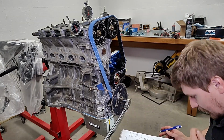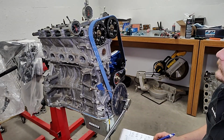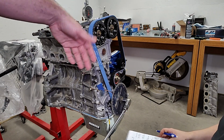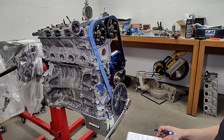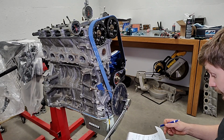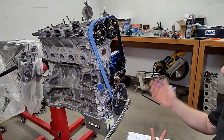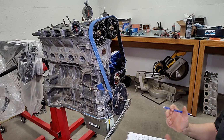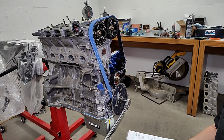Exhaust is on the nuts at 112.5 degrees, so I'm not going to be able to knock off a 0.5. Chasing a half degree right now is kind of pointless because you're very well going to move this anyway. After I've degreed them and we put them on the dyno, we've been super ecstatic with the power, so we've never gone hunting. That's because of the quality cams you're purchasing. You're already purchasing a product that's proven, you're just making sure to dial it in.